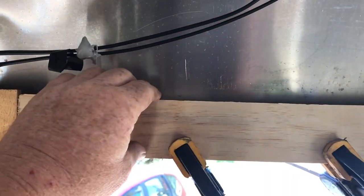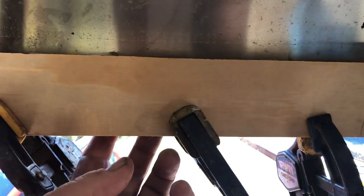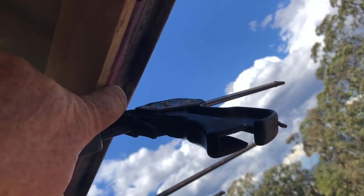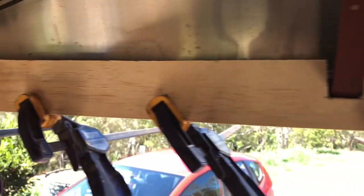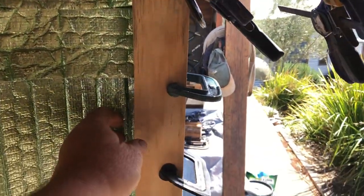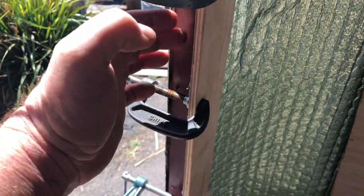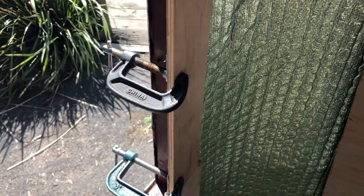When it comes to installing these small sections over the windows, there's not really anywhere to screw — if you screw through you'll come into the window cavity behind it, and you don't want screws protruding where your windows have to go. So we basically just glue those in position with Sika Flex. This whole timber section over the rear window is the same — just glued in — and then the corner goes over the top, which holds it in position. A trim goes over here too, which further secures it. You could put a rivet through if you wanted, but the Sika Flex will hold anything.